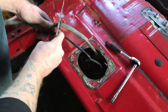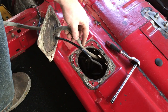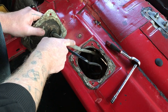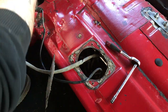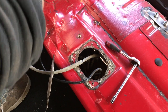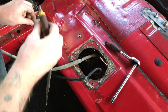There are two cables running through it. First is the fuel gauge wire and pump wire. This other one - I think it's a speedometer cable for the newer models - so this one can stay in place. But the fuel/pump wire has to be disconnected. Over here there's also a Torx screw for the ground pump - put it back so we don't lose it.